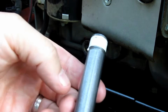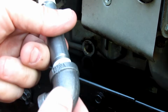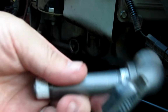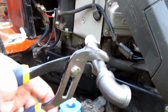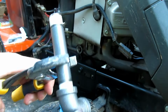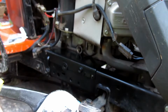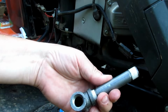What you might want to do is take a pair of channel locks or a pipe wrench and another one here and tighten this up, just so you don't get any leaks. I'm going to take this assembly and hang on to that pipe with my channel locks, and then really I can probably just tighten it up by hand, but if you want to get after it a little bit, just take them like so. Just be careful not to booger up the threads, and then tighten that up. So then you've got that, and you've got your Teflon tape on the other end.